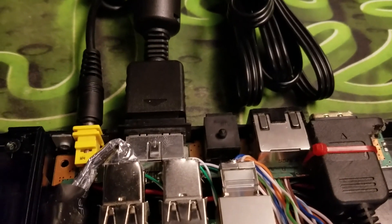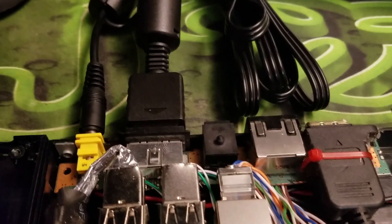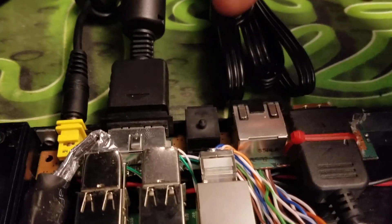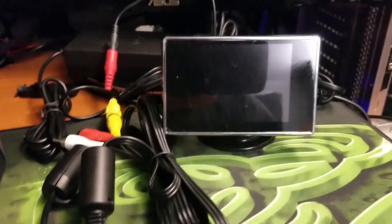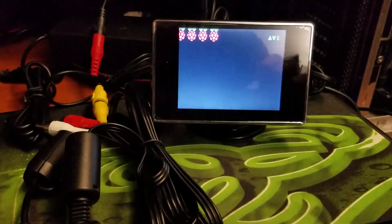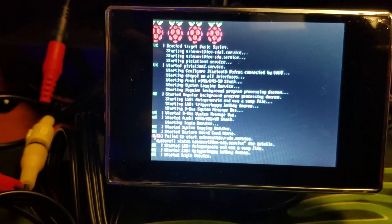And then out the back, all of the original connectors from the PlayStation 2 are there and they're all working except for the optical output, because the Raspberry Pi doesn't have optical. From the left there's power, then the audio/video output, optical, and then ethernet — that is connected to the ethernet port on the Raspberry Pi. And then HDMI was added. The composite also works on this; I've got a little 3.5 inch composite LCD — you can see that it's working, though of course because it's composite it looks like crap.